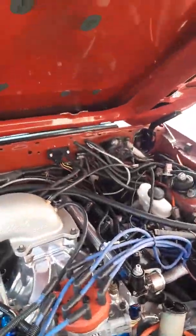We also did the rear brake conversion. I've got the Cobra master cylinder, but the problem is the brake booster. There's no way this car can stop — especially going 125-130. I went to stab the brakes, they were kind of there, and then I hit them again and there was nothing. It scared me half to death. The Cobra brake booster is the size of a basketball and it's not going to fit on a tall-deck Windsor block in a Fox body.